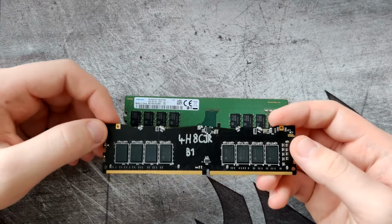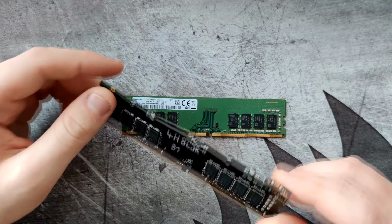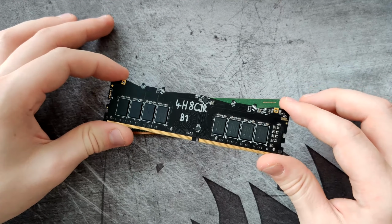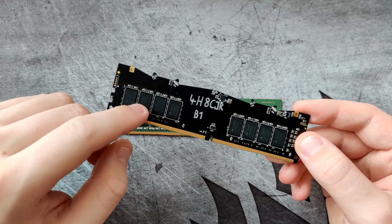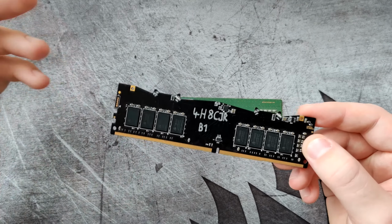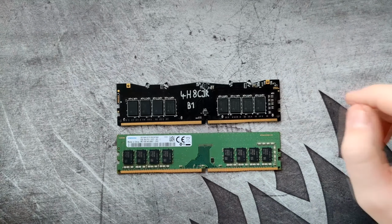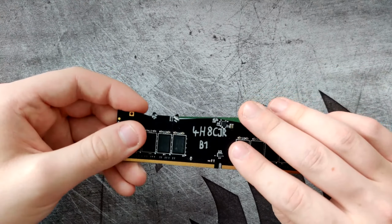So this is a Hynix 8 gigabit CJR stick. Specifically, it's the Corsair one that uses the dual rank PCB, but is actually only single rank. This one does about the same settings. This one runs a little bit higher frequency, it runs better TRCD, but this one does worse TCL, the exact same TRAS, worse TRFC. In some things it does better, some things it does worse. I'm pretty sure by the end of it, if you set sub-timings and tertiaries, they're going to be roughly equal in terms of actual performance. So this OEM stick is roughly equal to a CJR stick.